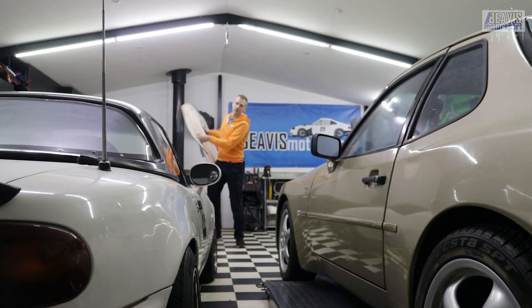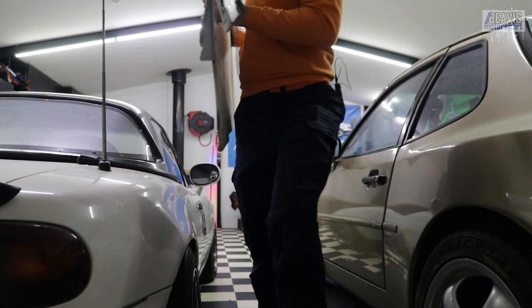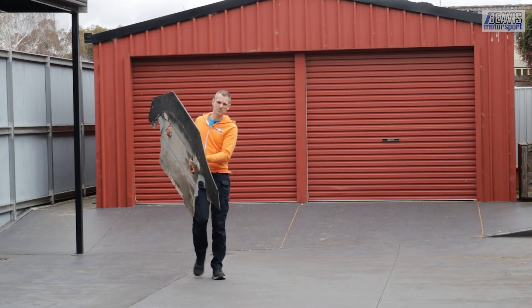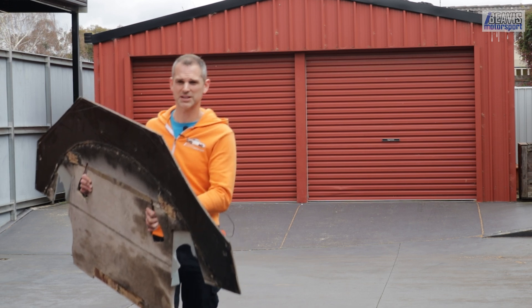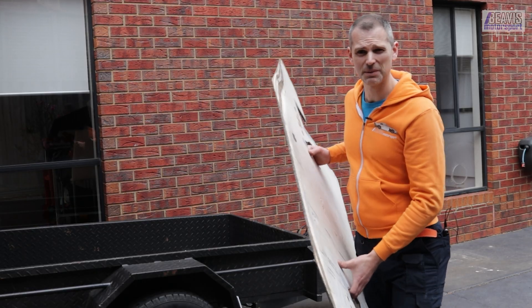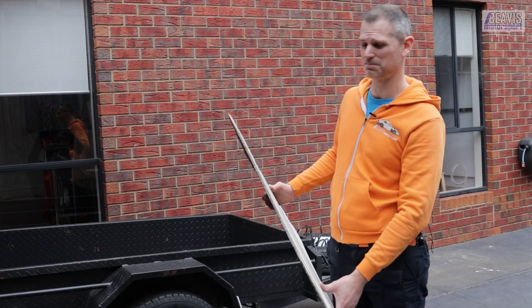So it's time for an upgrade — stronger, smoother, more aerodynamic and built right here in this shed using materials that aren't exclusively held for the Formula 1 elite. The old design wasn't terrible: a single sheet of plywood, simple with mounting points, but it was thin and flexed under load. That flex meant inconsistent aero. The aluminium mounting points had cracked and been damaged; I'd re-welded them multiple times but by the end of it, this thing was done. So the goal for splitter version 2 was to make something thicker, stronger, and that could put up with my abusive driving — aka curb launching.